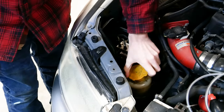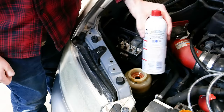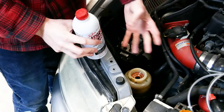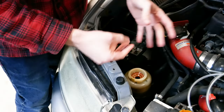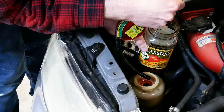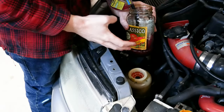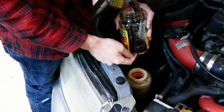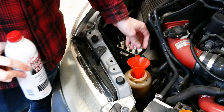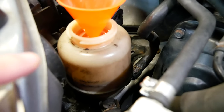Next up, we go ahead and open the power steering reservoir — some of them pop open just like that. You need to put 4 to 6 ounces of TransTune into that reservoir, so you can measure it or eyeball it. To remove fluid to make room for the TransTune, you can use something like a turkey baster or a siphon. I'm using an old antifreeze tester, which does basically the same thing. Use a container or jar to track how much you removed, and a small funnel to add fluid so you don't spill it.